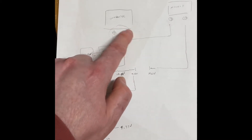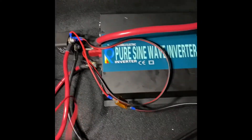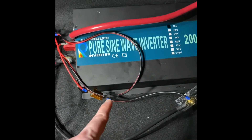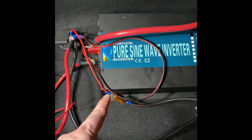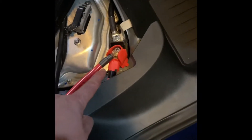On the inverter, if I measure both poles it's 4.33 volts. Working in the dark here — across those two poles it's 4.33 volts, but if I measure from one terminal over to another it's 14.4 volts. On that side of the resistor it's 14.4 volts; on the other side of the resistor it's only 4 volts, and consequently up there it's also incorrect. I've run everything through and zip-tied it up with this heavy 1/0 gauge cable. Over here it's 14 volts, which is good, but I'm not sure why it's not lighting up.